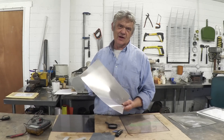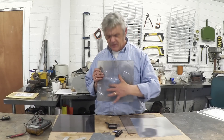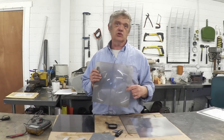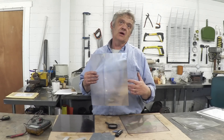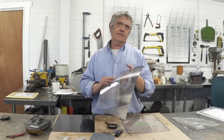Now there are two kinds of fresnel lenses: this linear one, and then there's this kind called a spot fresnel. If you run your finger over the spot fresnel, you'll feel that the ridges are circular — this is the stuff that people use to burn wood. The linear one will not create a focal point because the ridges are linear, but it will bend the light so that it enters your solar cell straight, even if the light's coming in at an angle. The research suggests it should make your solar cells more efficient by capturing light you weren't capturing before.